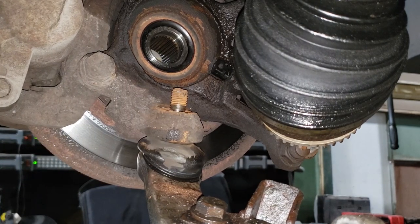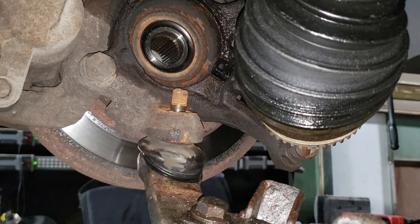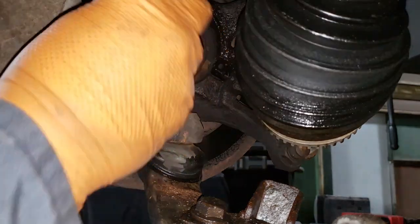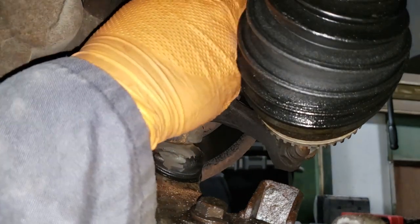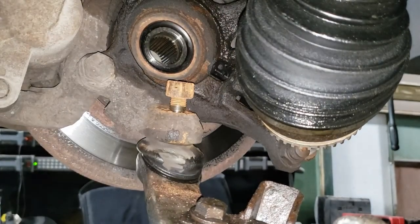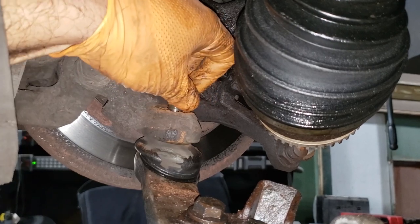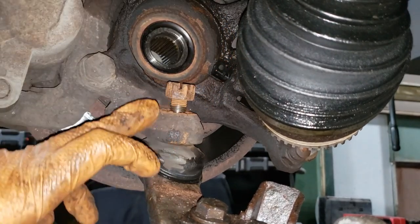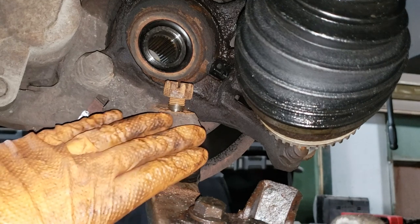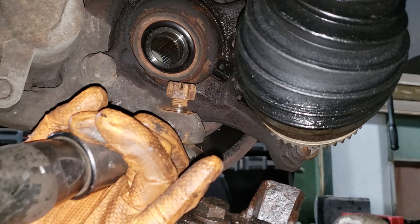Wow, the control arm is very close to my camera, so now I'm afraid it's gonna hit it, damn it. Anyhow, let's put the nut back there so that the control arm does not fall and damage my tripod. Thread that garbage back on there, good to go. Now, because this is a garbage joint, we don't care about the nut or stud, so we're just gonna hammer the nut and stud predominantly instead of the spindle. That way we don't leave too many scars on the spindle. Turn this guy up to 10 and hit it.